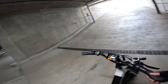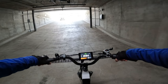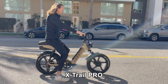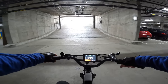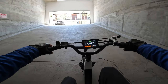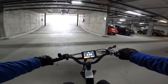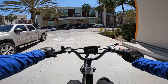Going to do the hill test on the X-Trail Lite from Bandit — 20% grade. I weigh 200 pounds, full throttle, sport mode. Not quite the same amount of torque as the pro version of this bike. So if you're looking to climb super steep hills, you might want a little bit of a rollout at five miles an hour, and put in a little bit of pedaling on pedal assist one. You kind of have to pedal this one a little bit to get up the hill. Or if you're really against pedaling, you can just roll into it at about 13 miles an hour, full throttle it, and you can make it up.